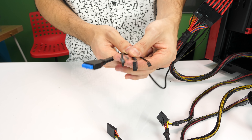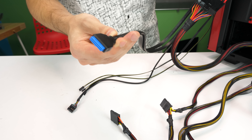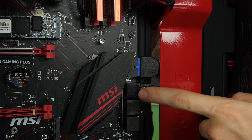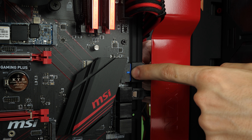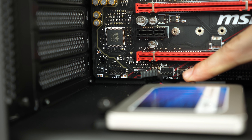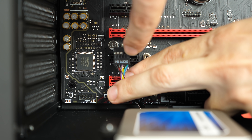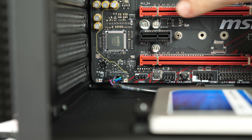All these cables are connected to the case and power the front panel. Start with the one with the blue tip — this powers the USB 3.0 ports on the top of the case. It connects to the USB 3.0 header on the motherboard, right above the SATA ports we connected for the SSDs. Make sure the notch is aligning with the gap, bring it close, and gently wiggle it inside. You may need to apply some extra force since it's pretty stubborn. The next cable is labeled HD audio and connects to the bottom left side of the motherboard. Route it from the back next to the SSD. Make sure the holes on the connector align with the pins before inserting, with the HD audio label facing upwards.